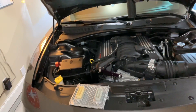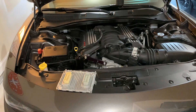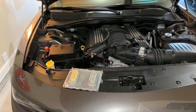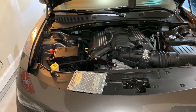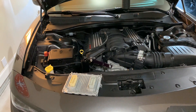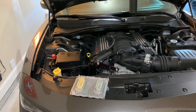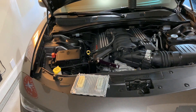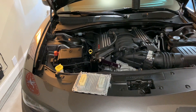I waited until I got a little over 16,000 miles on the car. I haven't had any noises or troubles out of it. I feel safe replacing this PCM. I know it leaves a code in the BCM, but I kept the factory one so I could put it back in if needed. I don't plan on going anything extreme with this car — I just want a light tune to take some of the nannies off, without changing engine values a whole lot. I think taking some of the torque management stuff off is going to make a big difference in the car.